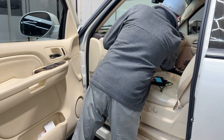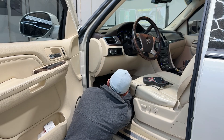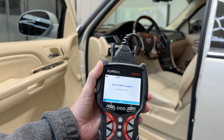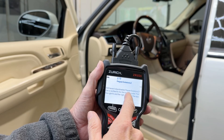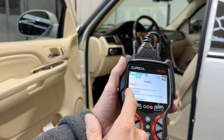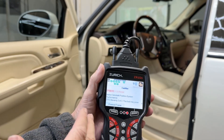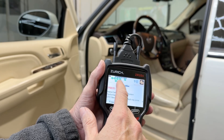After a few easy setup questions, let's get the radio off and get this plugged in. Autolink is in progress — running through — and it's at a hundred percent. The intake camshaft position sensor on the front of the motor on these GMs — it's such a common issue. And everything else is green here, so that is a good sign.